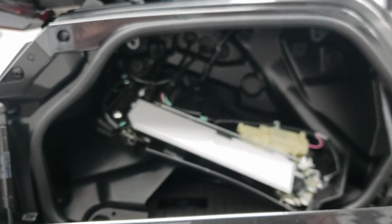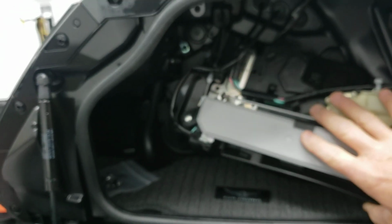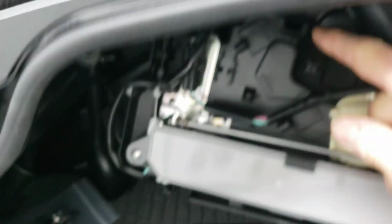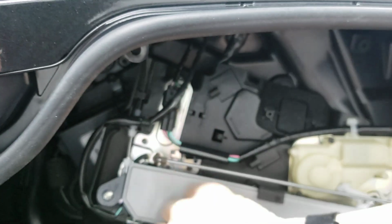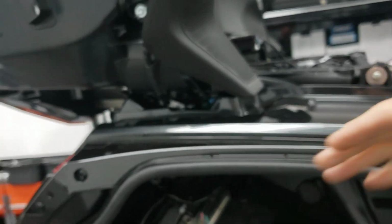So, assuming you've already installed a CB, hidden underneath here, here's a cover. You have to have the switch assembly down. There's the CB in there. That's a whole other big job. So the switch is down so that you can pass the cable through. There's a hole hiding right down in here by this big rubber boot. It has a rubber plug. You pop the plug out, and then it'll feed down through this hole, right in the top, and plug into the empty port in the CB. It looks like a traditional antenna cable you're used to seeing. And then a cover goes on the CB, and the switch goes back up.